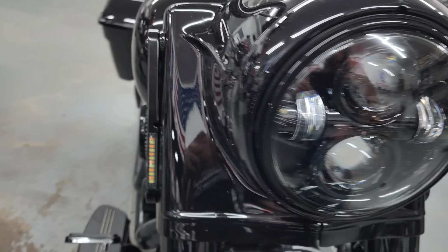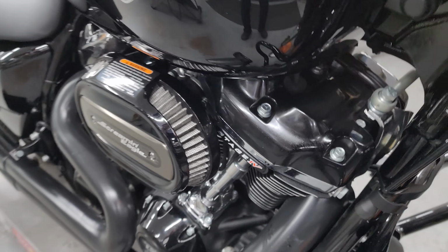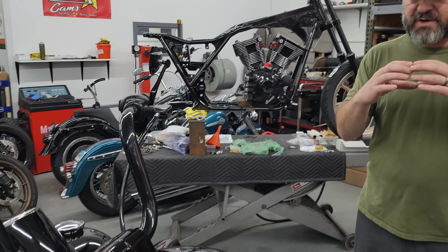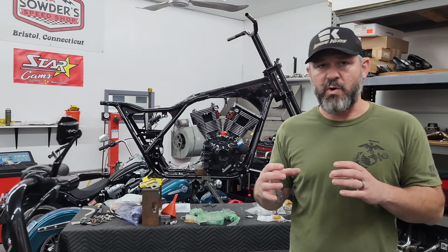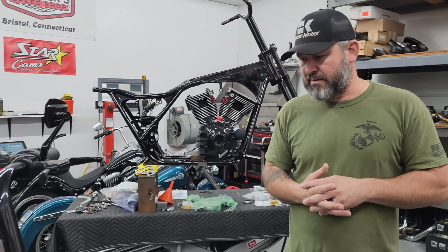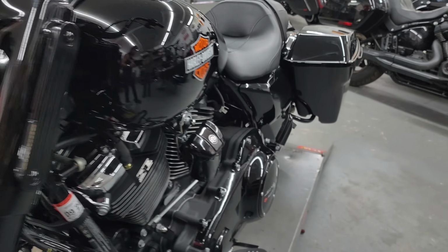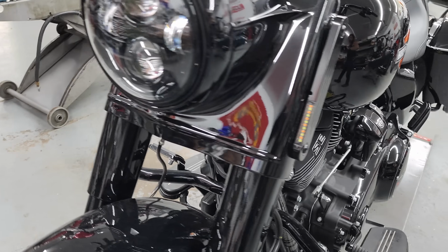And so even though this is a 4-valve head like that one as well, they made a ton of improvements on that cylinder head on these new motors. They changed the combustion chamber. They changed the intake track. So instead of having a traditional round intake track, they changed it to more of a square port. So that increases the flow a ton. And then instead of the off-camber way that this intake track goes in, they made that an on-center manifold.